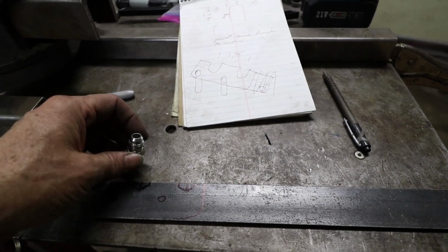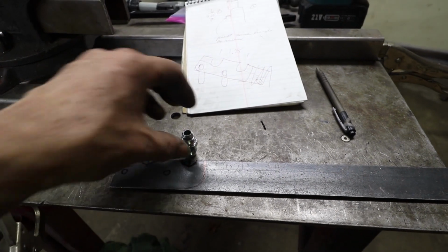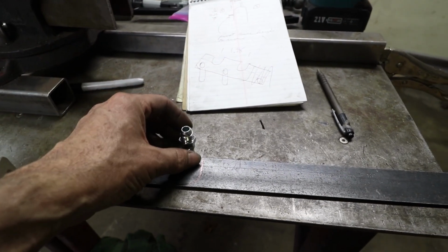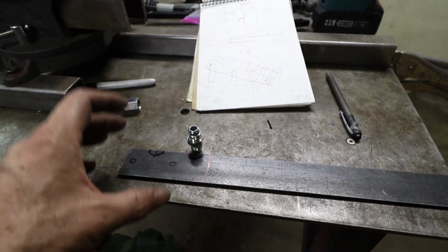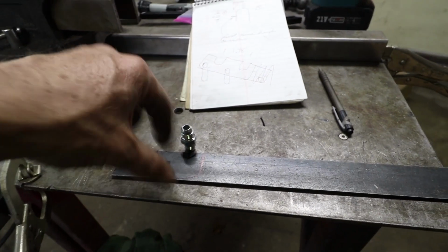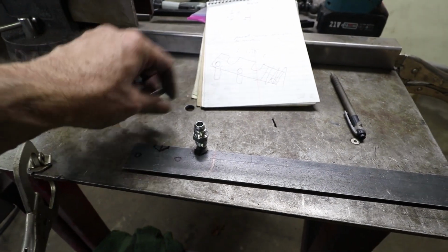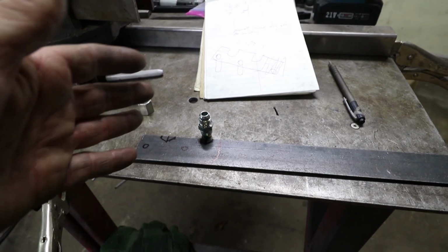That's going to make it so that you don't need to get wrenches back behind the cross member to take the engine out or take the supply and return lines off. These will be welded essentially to a bracket which is bolted to the car, so you can just spin the nuts off when it comes time to remove the lines. These will likely be flexible lines because the engine vibrates, so those have to move.